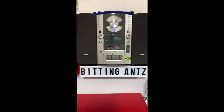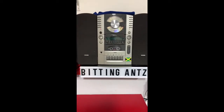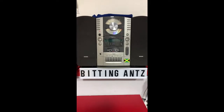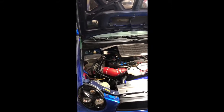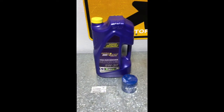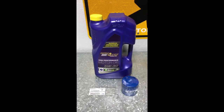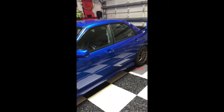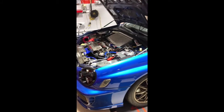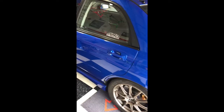Today we're going to be doing some work on my 2002 Subaru WRX. I do quite a lot of work on my personal cars and I figured it's time I start documenting some of this stuff on YouTube. We're going to be doing a standard oil change today. We have the Royal Purple 5W-30 synthetic motor oil, an OEM crush washer, and an oil filter. We're going to get the car up on some jack stands in the front and get the oil warm by starting the engine.